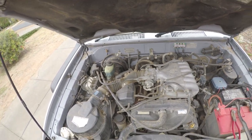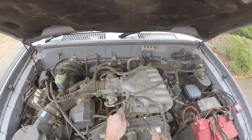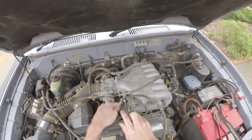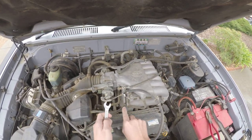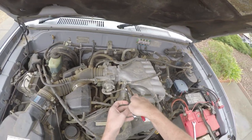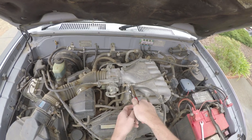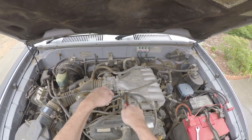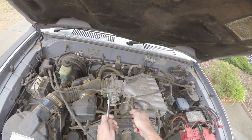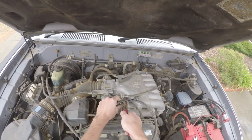All you do here, pretty much, is loosen off your lock nuts, which are locked up opposite ways. Now you'll see that this will turn. This is why you need the pliers. So have a pair of pliers on the end there, just a pair of ball nose pliers or flat nose, whatever you want to call them. And you just back off, or tighten up in this case. The more I back that off, the worse it'll get.